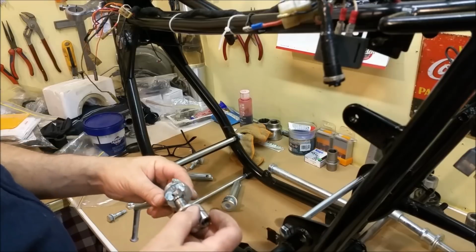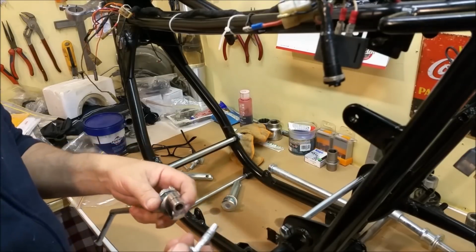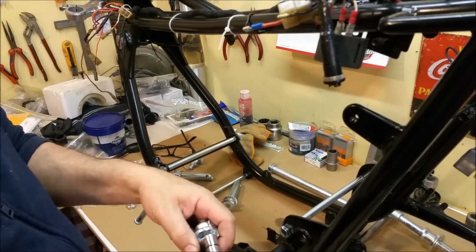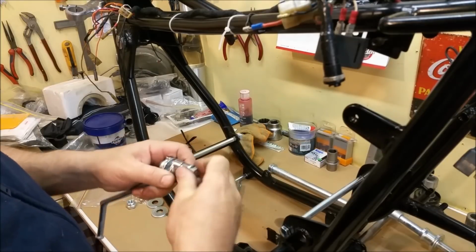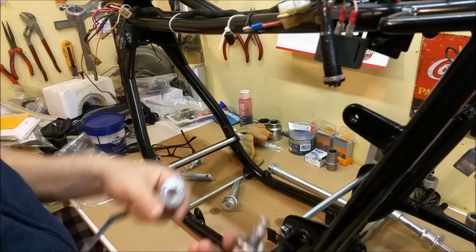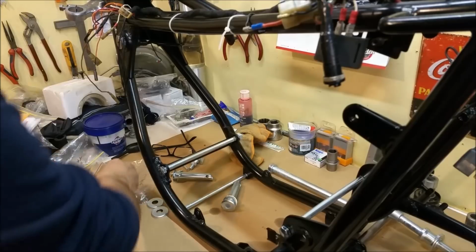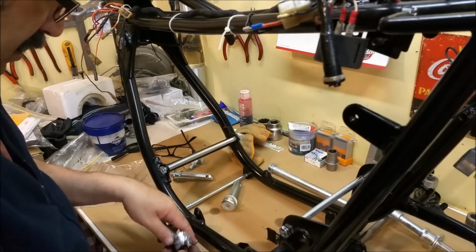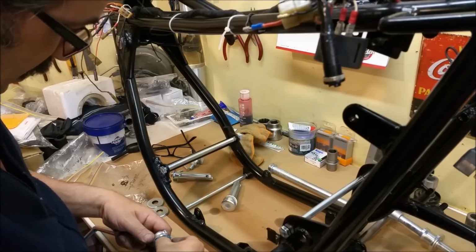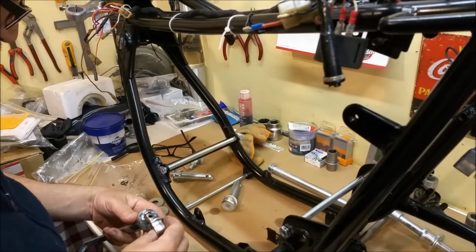Right, this guy goes in here, and there's a big gap there, and this thing keeps rotating. What I didn't consider, or it sort of dawned on me later, is the Kickstarter bolt has an increased shank on it, and as you screw that guy in, that is what stops it rotating. So it sits into those pockets there, so I learned something there. But it's just a matter of figuring out how this bloody thing goes together. Oops, I might have to use tweezers or needle nose pliers or something, because this is going to be a horrendous gig. I wonder if we pop this.